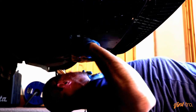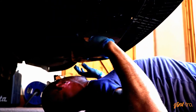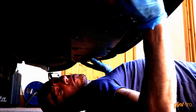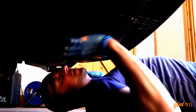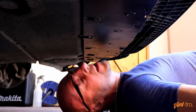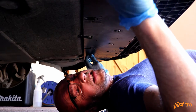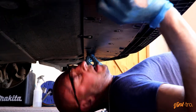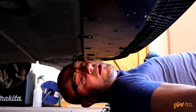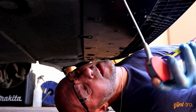Now by putting that screw in the middle has allowed me to actually hold that in place, and now I can locate the rest of the screws in here. And I'll give them a final nip once the bumper is actually located. But something I was taught when I was a young lad was whenever you put a screw or a bolt back in its recess, always just give it a little bit of lubricant, because the guy who taught me my trade always said, you make it easier for the next man, whoever takes it off, and that just could be you. So here we go, I'm just gonna spray just a little bit